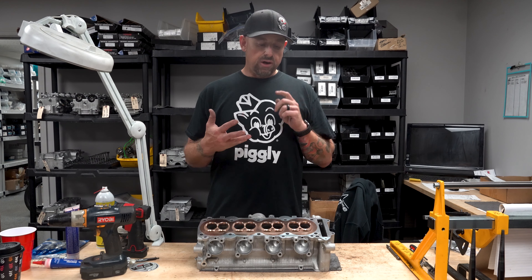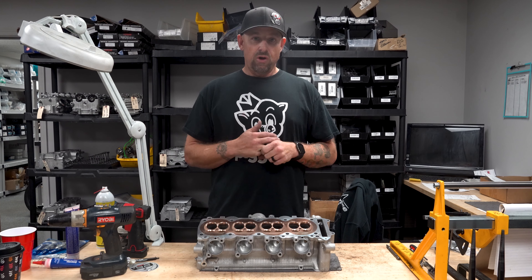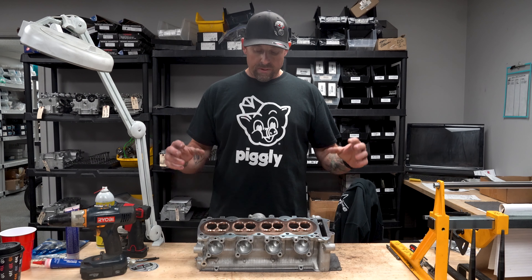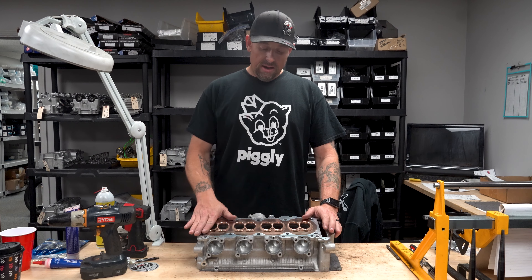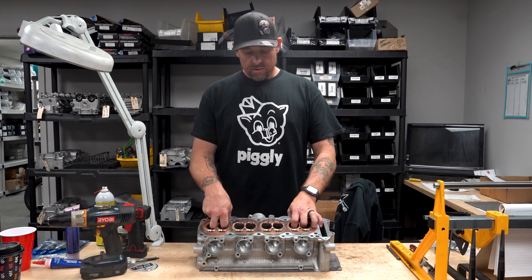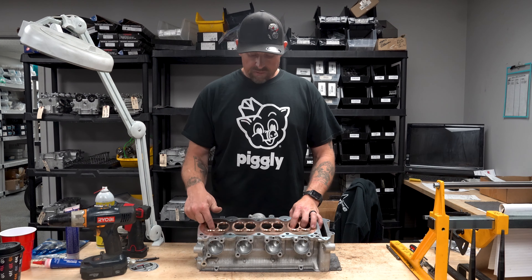It's really good for machining, you can weld it and repair it. We chose to take our current modern-day cylinder heads, CNC out all the water jackets, and put a one-piece unit skull into the head. As you can see, it has the chamber mod CNC'd into the head, our competition valve job that we do on our new contour BB, and it also has new spark plug threads put in there.